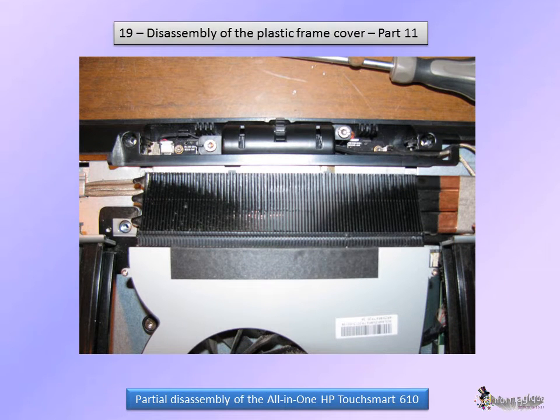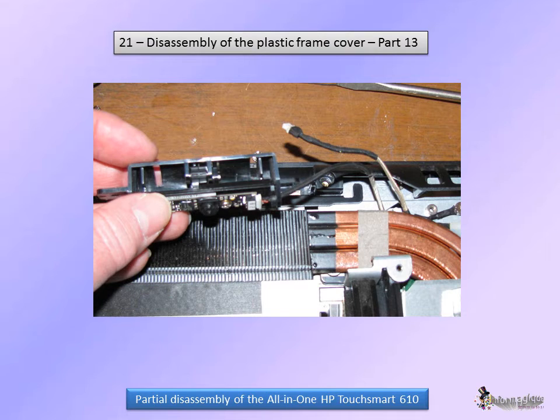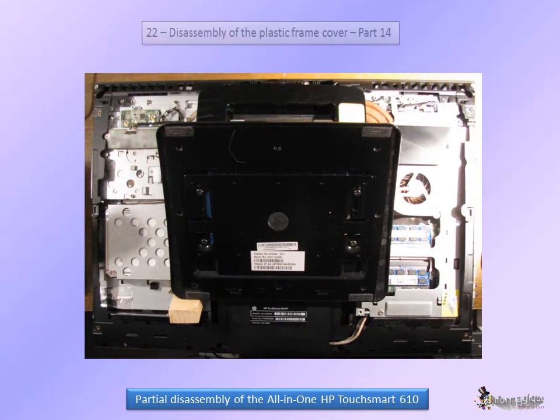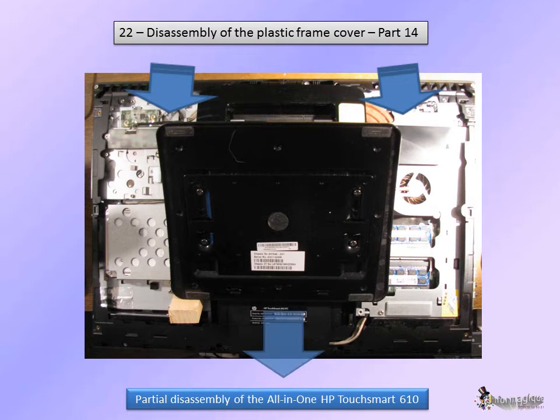There is still something that prevents you from removing the frame cover: the webcam at the top of the screen. Remove these two screws and take these two wires out of the passage on the right. Slide the base up and keep it in that position. Then you can loosen the frame cover using a credit card that you insert under the frame all around it. If all the screws have been removed and you insist a little, it must come out rather easily. Finally, you will need to put the webcam out of the way — disconnect its two cables. Now you may take the frame cover out. Start by raising its upper part, then keeping it raised a little, slide it under the base — still in its high position — in this direction.